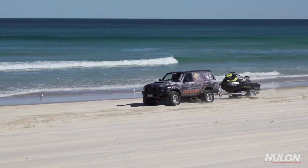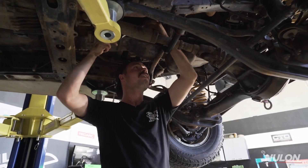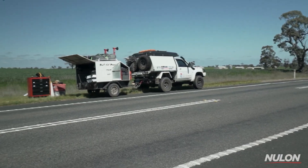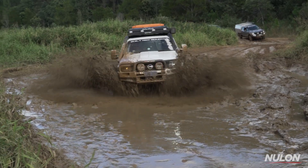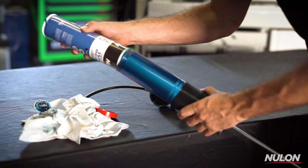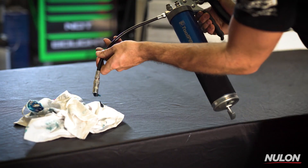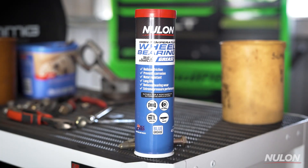One of the biggest mistakes of anyone taking off on a big trip or weekend away is not checking and topping up your grease points. Using the wrong type of grease in things like wheel bearings, uni joints, or half shafts can turn a fun weekend away into a not-so-enjoyable side-of-the-road meltdown. Typically if you spend a lot of time in the mud or river crossings, the bearings and universal joints tend to be harder on the grease, so topping up your grease points ahead of a trip will fill these areas with a fresh grease additive package and ensure you have a trouble-free trip.